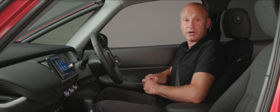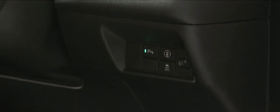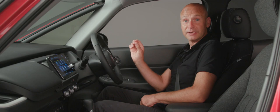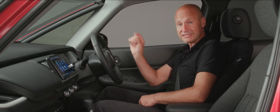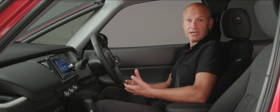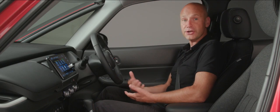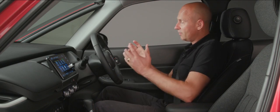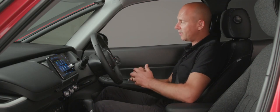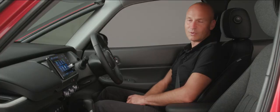To activate or deactivate your parking sensors, there's a little button marked P just by your right knee. Press it and it illuminates green, meaning they're on, with momentary confirmation in the instrument cluster. Press it again, the green light goes out and the parking sensors are off. While we're in this area, it's also worth pointing out where the horn is.